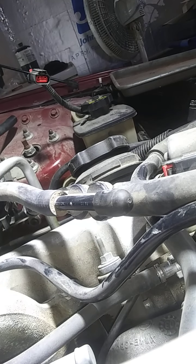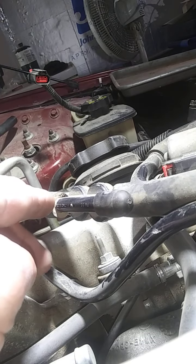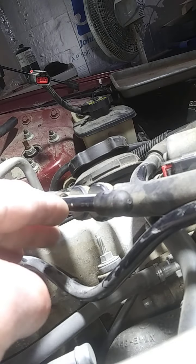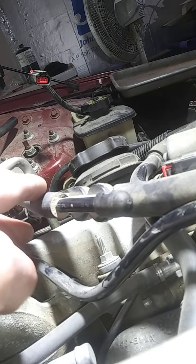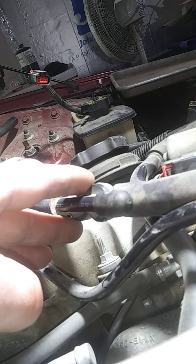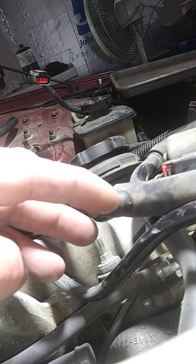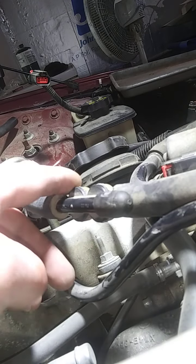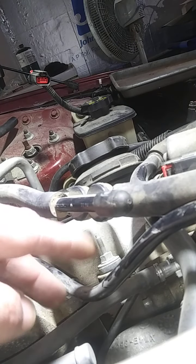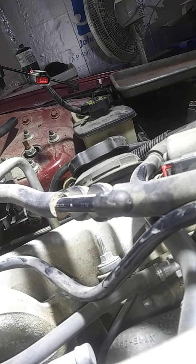But let me see if it's in view there. Let's see. This guy right here, that's a valve that goes up from the brake booster, then down in, and I don't know if it's a single bypass or so it can't blow back by. That's a rubber cap. This hose is split. That's vacuum lines. Watch right around in here, and hopefully you can see smoke coming out around there.